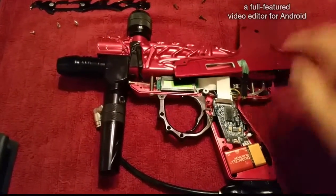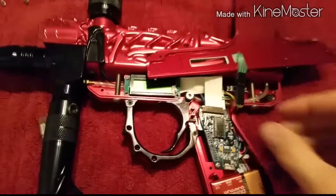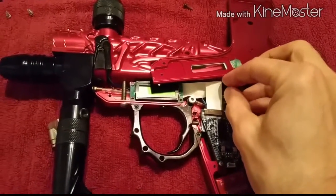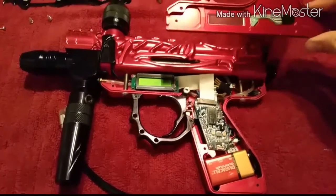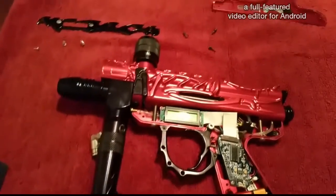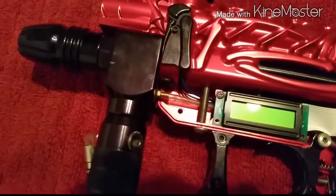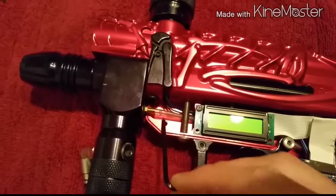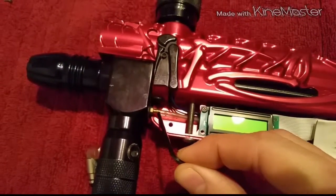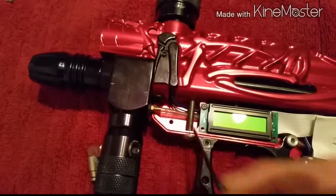This piece right here you can disconnect — you just pull that apart. I'm going to set that aside. The place where it's leaking is right here behind the LPR and HPR. The leak is coming from right there off that air barb, and I'm going to replace this hose.